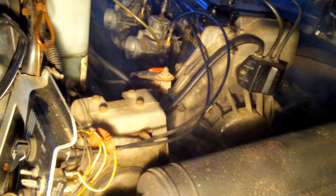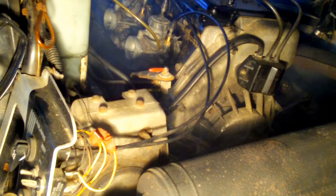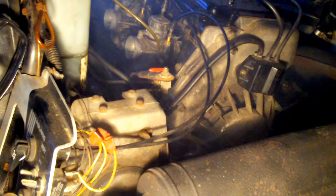I do have the door open in the garage — the side door, the main door, and one of the window screens — and it's a windy day. I've already looked at the tachometer and the idle is around 3,000 RPM. So I'm going to back these out half a turn on the idle screws and start it up again and see where we're idling next.